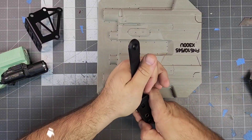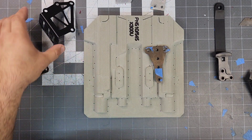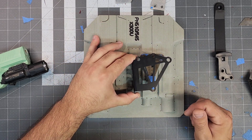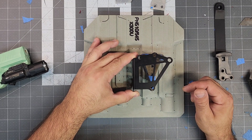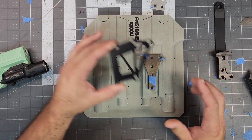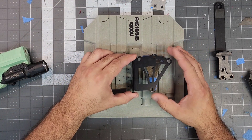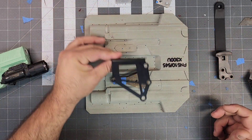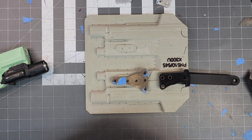I've got the blocking that we need. We know the sight channel is going to be in the center once it's folded, so this blocking has to go over that sight channel. Having it way over here is going to be the only way to do that. If we want it to sit flush, that's how it has to be. It's going to clear everything — about three quarters of an inch over what I normally do. It clears the RMR, and the hood is going to sit right about there, braced with 0.093 thick clear material.